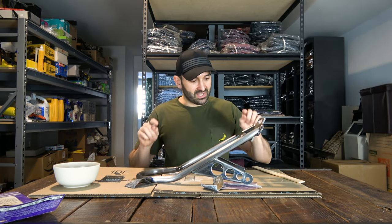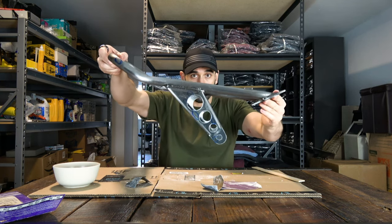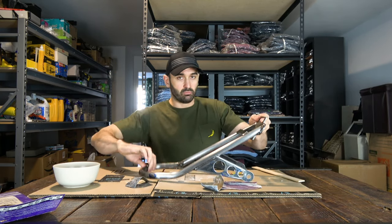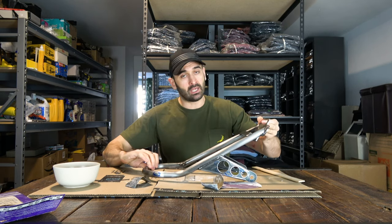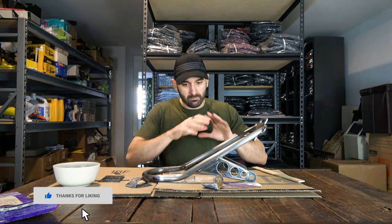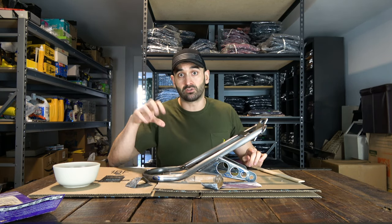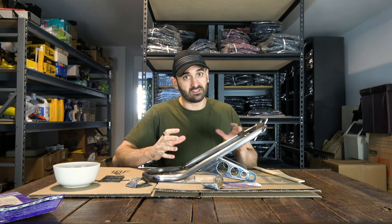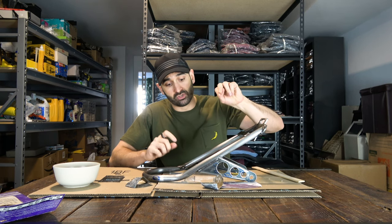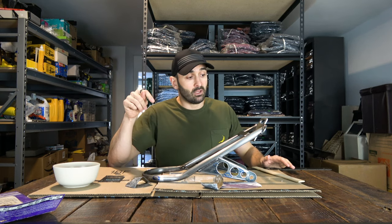We are done — I have all my runs marked. It's quite a bit, and if I want to show you those blue circles you can see right here, it is really hard for me to show the runs on camera because I really need to play with the reflection of the light. They are not huge runs; I really tried to make that piece perfect. Just one thing: you saw that I put that subframe in the oven — why? Because the paint was not super hard. So what I did is I put it at 175 Fahrenheit for two hours and that worked like a charm. Just remember: 175 degrees Fahrenheit for two hours.